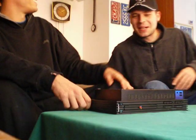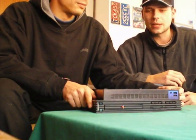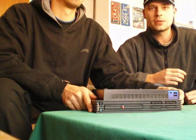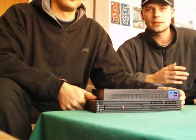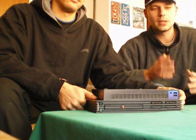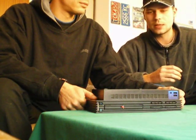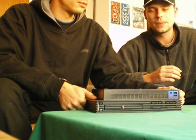Hi everybody. We had a problem with our PlayStation 2 — one of the controllers was not working. First of all, we had to check whether both controllers were fine, so we swapped both controllers between the first and second controller ports, and they were both working fine. So we knew it had to be the controller port itself.